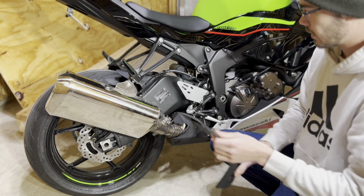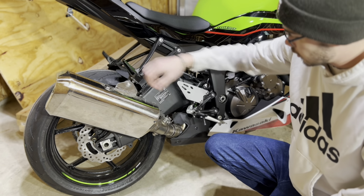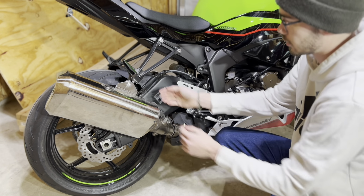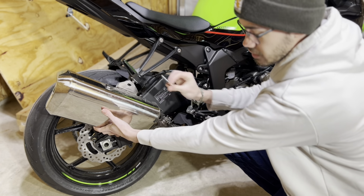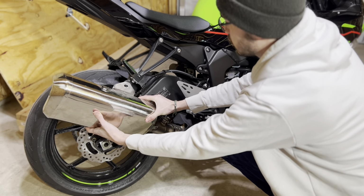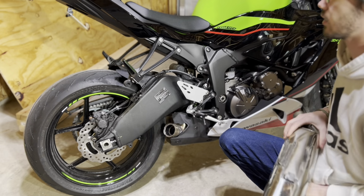And so you want to take that piece off, and that is going to expose the bolt for the clamp down here, which is going to be on the back end, and then you'll loosen that guy up. You'll take this bolt out, which does have a nut that goes on the back, I just don't have it installed, and then this will come off after you get the servo out. And the servo I had already previously taken out.